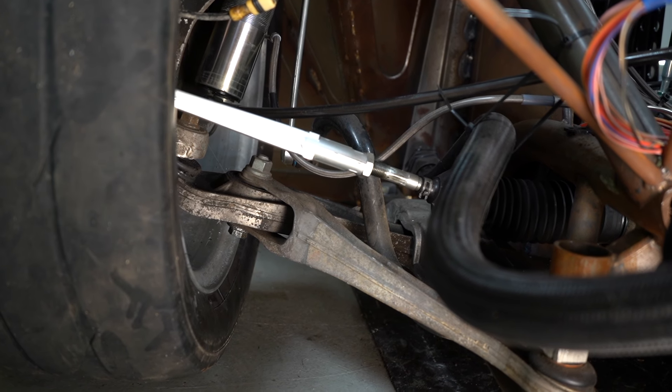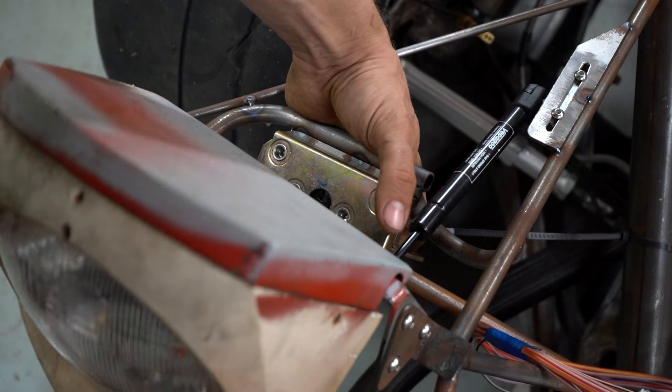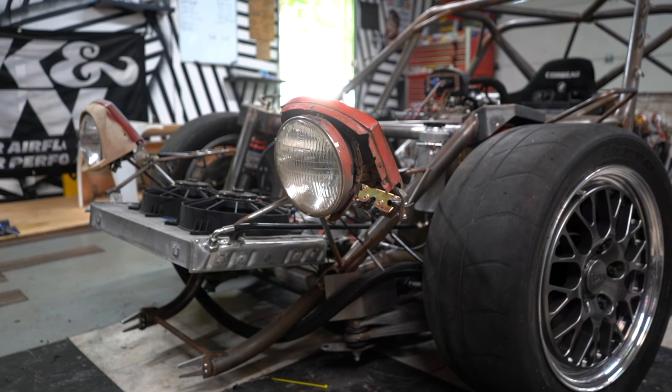The lower control arm is at a horrible angle, so it will have to do a roll center and bump steer correction. But honestly, don't look at that — look at the pop-up lights. We like pop-up lights. I love everything that I've done to this car this episode. Headlights — big deal. No one does pop-up headlights and they need to. Keep them on your cars, your race cars especially. Tires, wheels — great. Suspension — great. I love this haul. Next episode I'm going to work on the body. It went off to the sandblaster and it's going to get primed, but I then have to do all the rust repair. It's too humid here in North Carolina, so it needs to be repaired after it gets primed. We're also going to do some aero, so don't miss that. I'll see you next time.